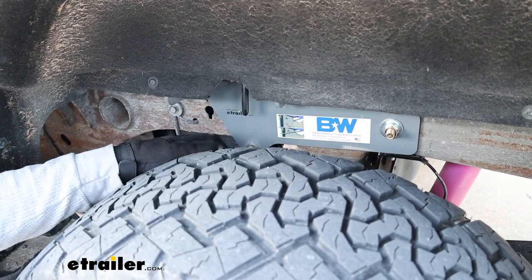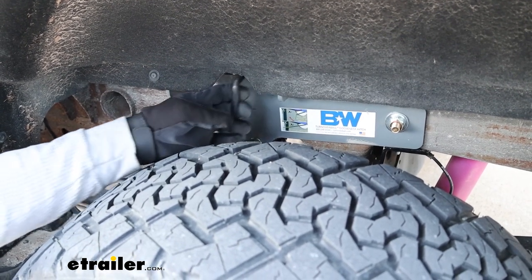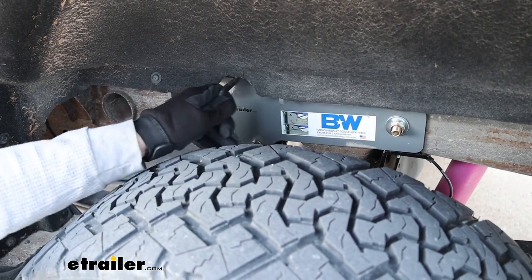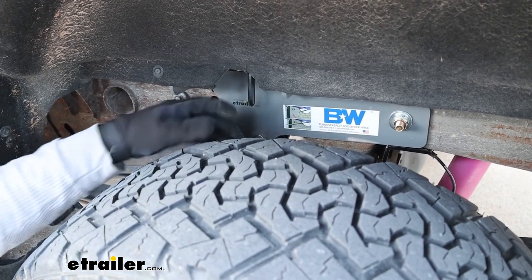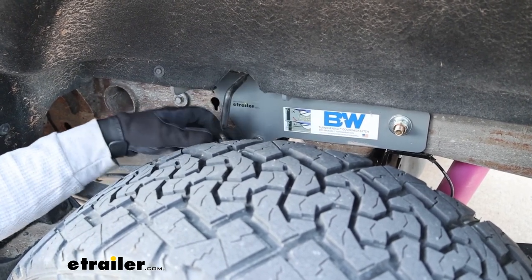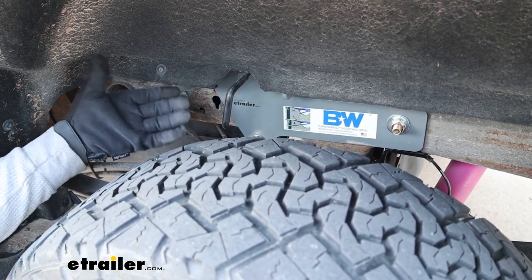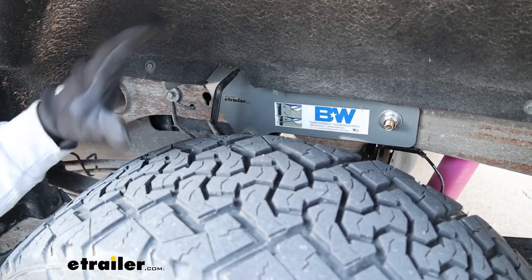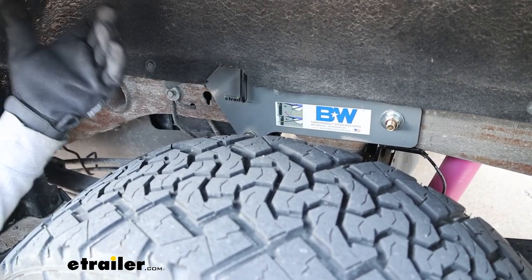Compared to some of the other hitches and other manufacturers, I like B&W's handle mechanisms. They tend to be really smooth and you don't really have to search around for the lock. Some of the other ones you have to kind of fight with them and they want to unsnap and everything else — that's just not the case with B&W hitches. You don't even have to think about it. Pull it out, bump it over a little bit, and it locks into place or unlocks. That's how the hitch operates — pull out, lock it, turn the ball around or do what you need to do, and when you're ready to tow, lock everything down.